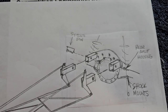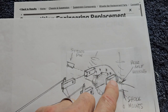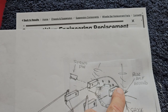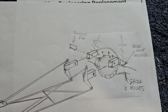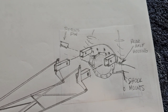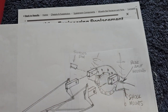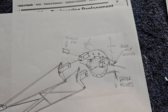I'll need some quarter-inch thick plate to make this piece, plus two different sizes of rectangular tubing so one slides inside the other — probably 12 to 14 inches long. I'll buy a 12-bolt rear end housing gasket to use as a pattern for the bolt holes. I'm going to find out if somebody has a water jet or laser cutter — I can design this into a print, have them cut the piece, and get a nice clean engineered-looking part.